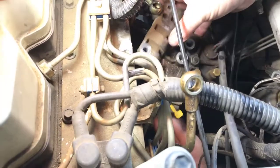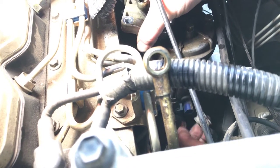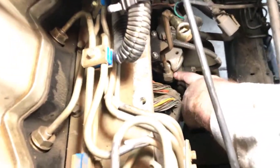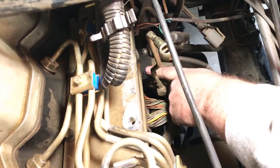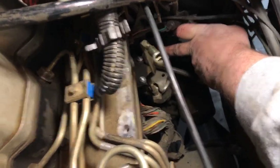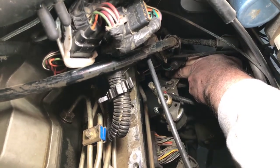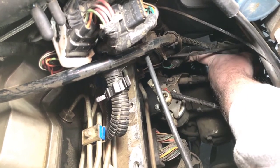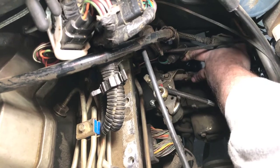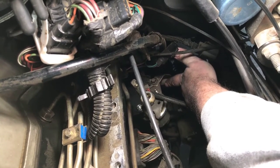There's a connector on the bottom of your fuel filter down here — I think it's the water sensor — so we'll just unclip that. Here's our lift pump. This is the problem with her. We're going to remove the two mounting bolts on top — those are 10 millimeter — unplug it, and take this connector off. This is the fuel supply going into it. There's a banjo fitting on the backside — undo that banjo nut. This is a factory fitting on here. I think we end up cutting this bracket off flush, so we'll have to remove this fitting from the banjo bolt and cut this bracket flush to fit it on the new pump.